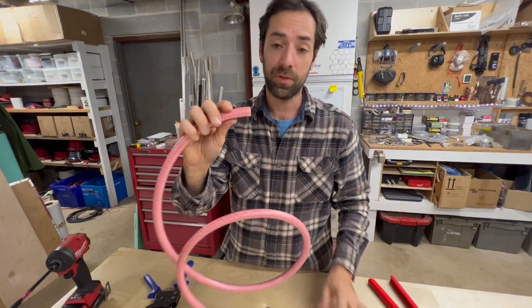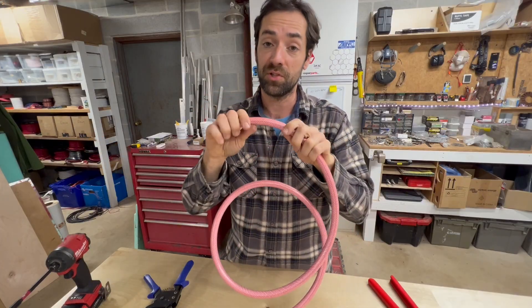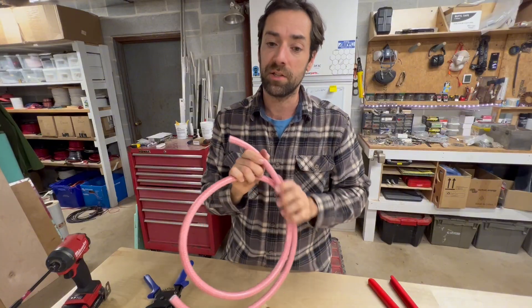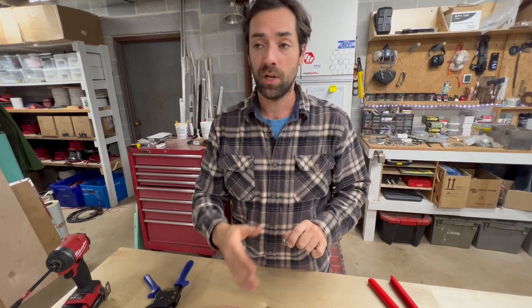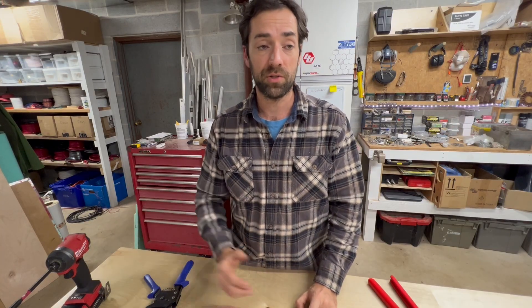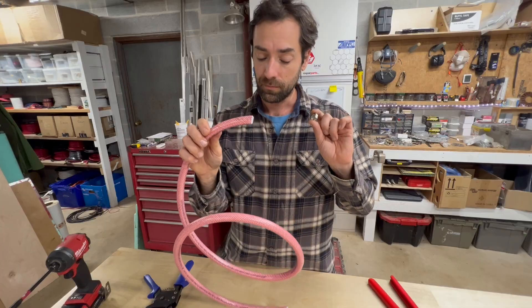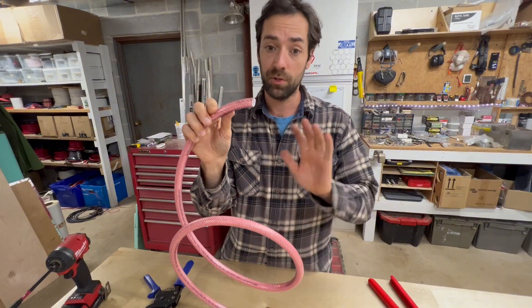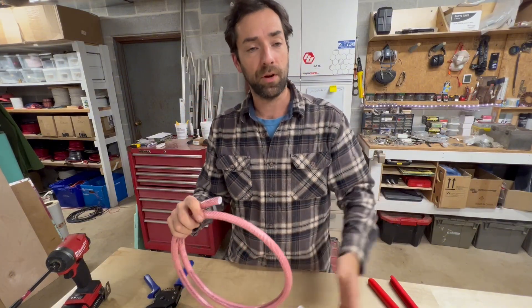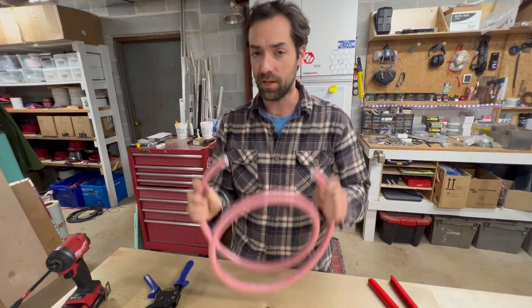They thought that over time, with expansion and contraction, and given that this tube is flexible and pliable now — what happens after a number of years? Is it going to get hard and brittle? Is it going to stay compressed around the fitting with the clamp ring? I did some research on forums for production-line RVs and travel trailers, and people are complaining about small leaks with this stuff on PEX rings. Nobody out there is recommending PEX fittings with this hose, and my plumber friends noted that hose clamps don't tighten uniformly around the hose — especially something this small.